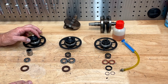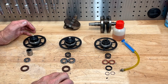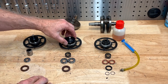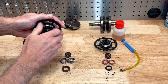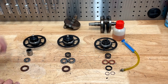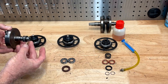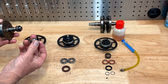The next one was only run for a short period — from around 2016 through 2017. It's the most uncommon one. You can identify it by the really big end cap on the seal setup — the end cap is quite large and it has a big bearing in the end. Now notice the difference between these clutches: between 2016–2017 and the newer ones, they changed the crankshaft. They changed the crankshaft journal size — as you can see, if you put the old one on the new crank, it's loose and doesn't fit. The old bearing was set up for a different journal size, and you can see the difference in size and cranking power the new bearing would have compared to the old one. That's why they upgraded when they went to the DFI and later model engines. So when you're ordering a clutch kit, you have to work out which one you've got.